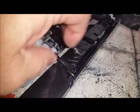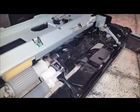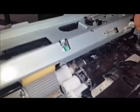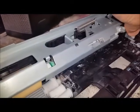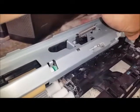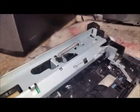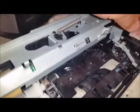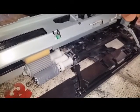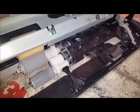I've got the new one in. What causes this thing to break is that there is a spring right back behind this plate here, and when this mechanism gets used for a while, that grease gets kind of dirty and it just doesn't pull back like it used to. So the spring back here isn't sufficiently strong enough to pull that back, so the sensor flag stays up there when you open the drawer and it snaps that off. It's supposed to pop back like that.